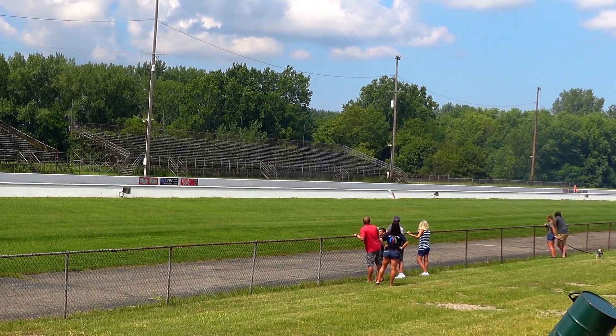We're just back from National Trails. We really wanted to get a few hits in today but ended up settling for one. They had a pretty full track and we waited around three to four hours to get our first pass in. The first pass went okay — we had a really good 60-foot, went 1.07 to the 60-foot, the g-meter looked really good, and the truck didn't do anything crazy. We have some things to work out: need to make a little adjustment on preload, had some issues with spooling and air-to-fuel ratio. We actually have a little bit of an issue with one of our spool solenoids. All in all, the truck is mechanically sound with no major issues going into next week — making sure we're ready for test day at Scheid on Thursday.